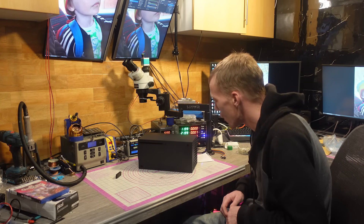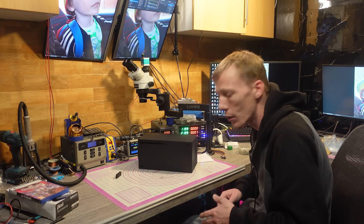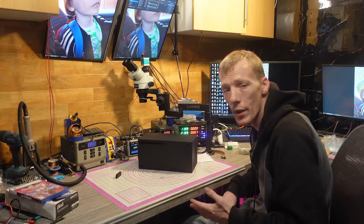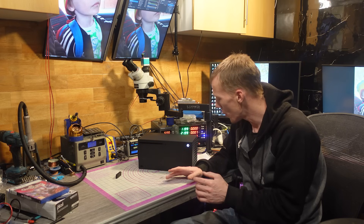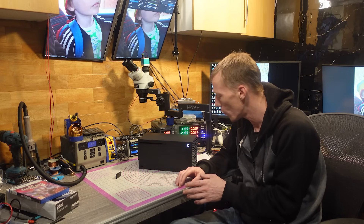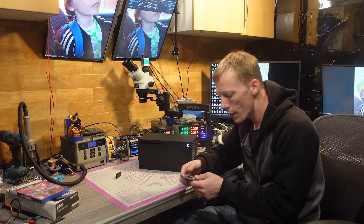There it goes — it just shut down, that was about a minute. That's not good; it means it's not recognising the SSD. Either there's no SSD in here, or the SSD is dead and we'll need to try and clone it. I'll try that once more just so you can see it's not me doing it and that this is the reason it's not displaying anything. If there's no SSD, it's no fix — that's it, done. Microsoft paired the console to the SSD with a security key. The only way to obtain that security key is with a cloning device.